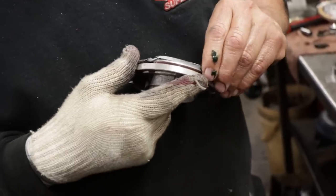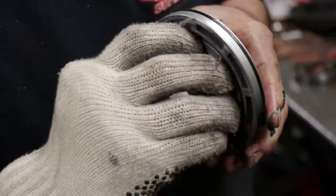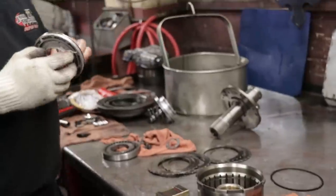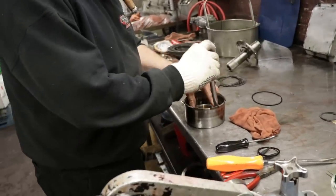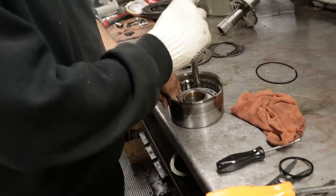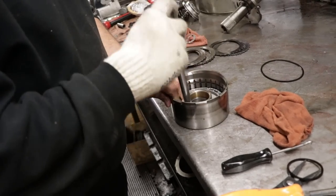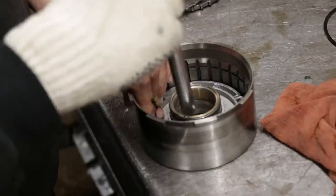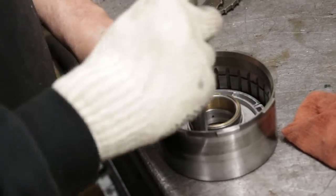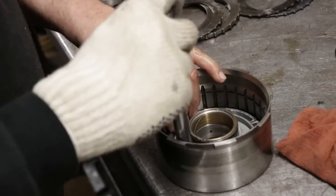On the newer ones, some of these pistons had a lip seal instead of a square cut seal. On the aluminum C4s, it's 64 to 71, 72 to 76, I believe, and a couple minute changes. Like this has a screw-in modulator valve, which the early ones had, but this transmission's a 72.